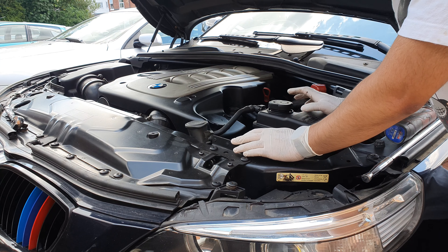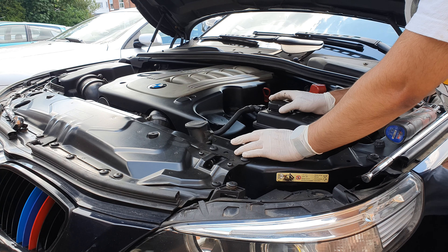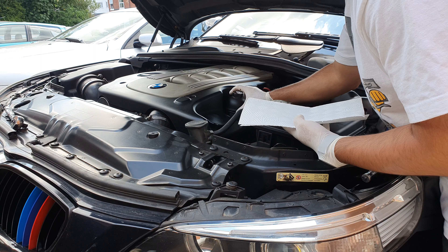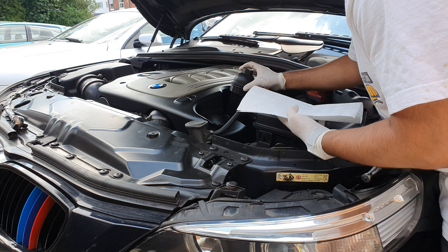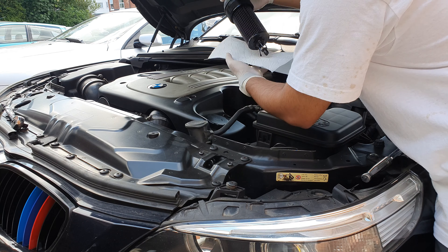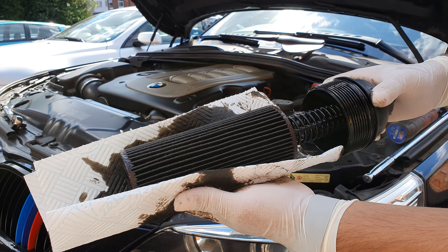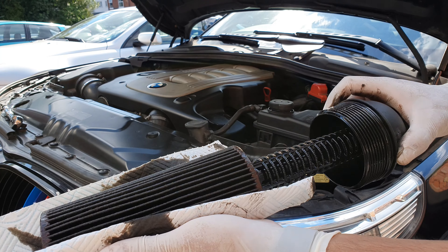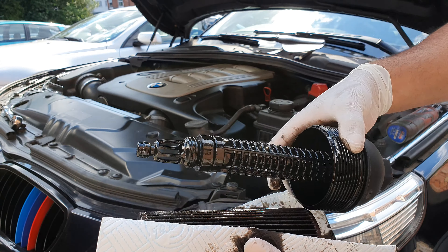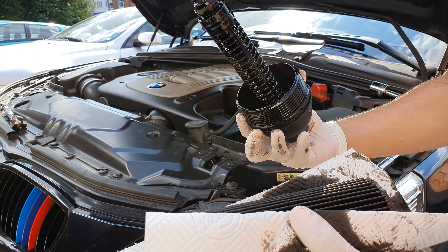It's definitely a good idea to get a quick little piece of tissue or something like that to catch the oil coming off the oil filter and the lid. I'm just going to grab the oil filter out of the housing first. From here you'll be able to just tug the oil filter off the housing — it gets a little bit tight at times. There we go, that's the oil filter off and the lid kept separate.